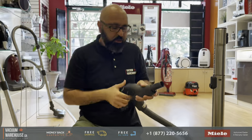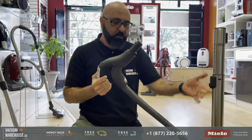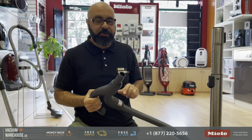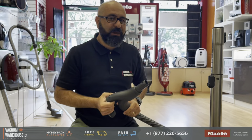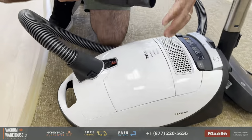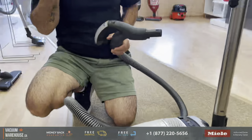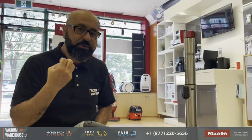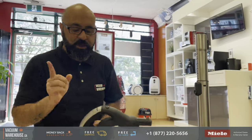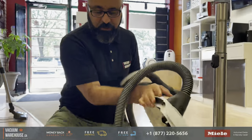If we have a new bag and no attachments — so we're not restricting the airflow — but we still get that indicator go all the way in, that's the first sign there is a clog. It sounds like it's not breathing, like the airflow is stuck somewhere. That is the first telltale sign of a clog. That's in case you have a full bag — if the bag is really, really full, you'll open this up and see it's like a firm pillow in there.